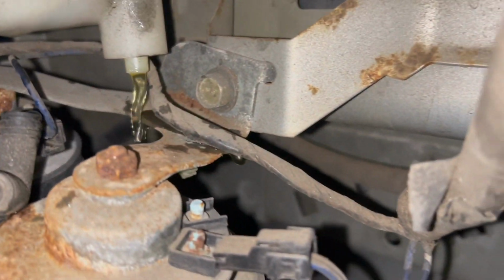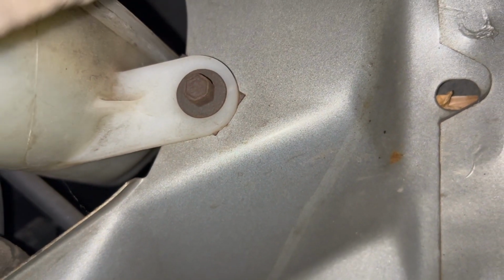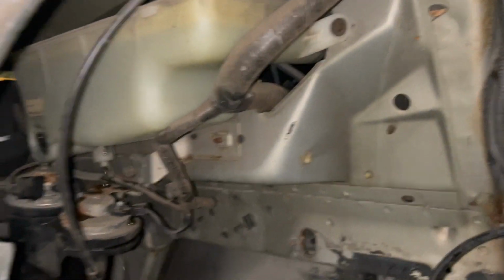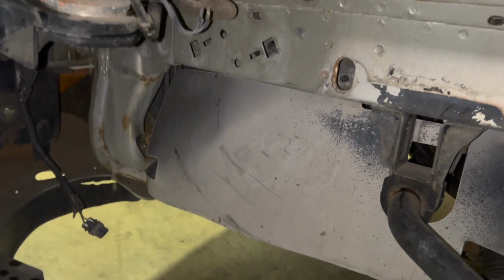All right, so I decided to pull off the connection here off the bottom and just drain it. Got a little container catching it, and then I'll take off this bolt, which appears to be an 8mm. I can pull the whole thing out and then get on the bench. Maybe the corroded area where the pump is, I might have to spray that down and try to work it out